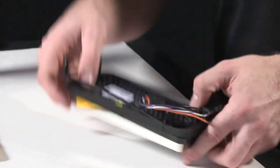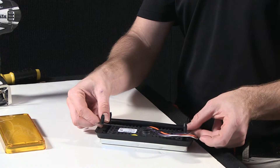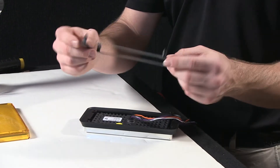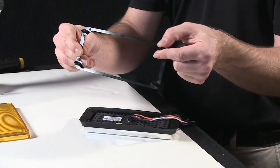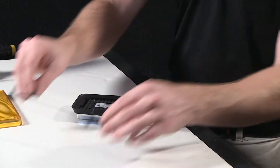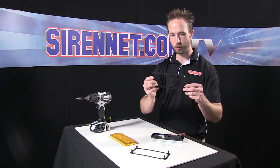The back of the unit has two pieces that assist in mounting. You have a polycarbonate 7x3 roughly surface mount adapter piece, so with this it'll go on the flat portion of your application — basically a screw hold. These will go into the holes that you drill for the mount, screws go through, and press out the little feet here to help lock it onto the body panels. To keep the unit nice and planted and even on the surface, there's a rubber gasket included as well.